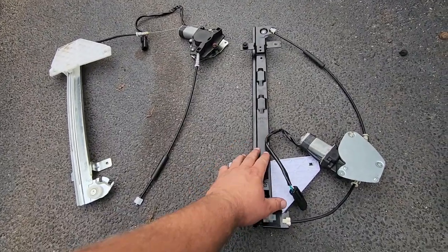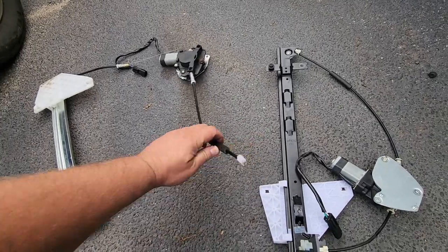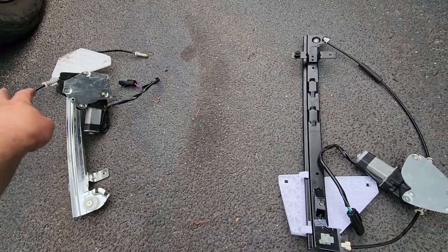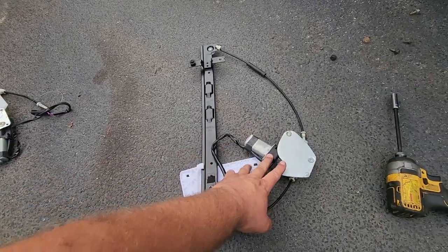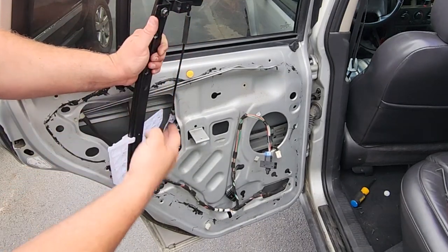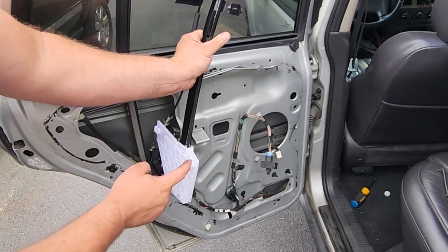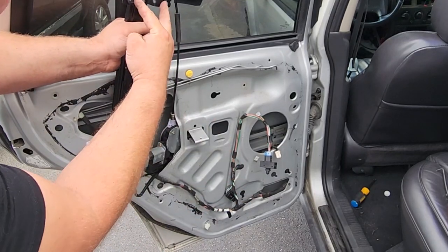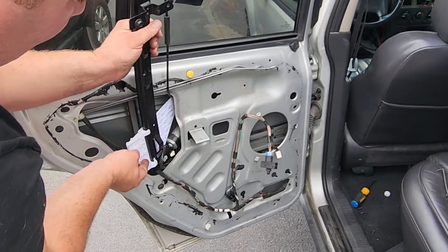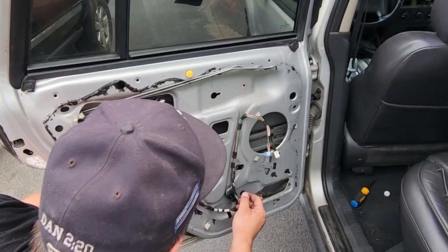Here's how it's supposed to look in the window — nice and neat, makes a nice loop. And obviously this one's broken — cable snapped. This is going to the scrapper. So we're gonna put the new one in. We'll slide her in nice and gently, follow the contour of the window, and make sure this is facing the right direction. We want the window to plunge into here — that's where we slide our clips. These two go up here. Leave yourself little clues to help you line things back up.